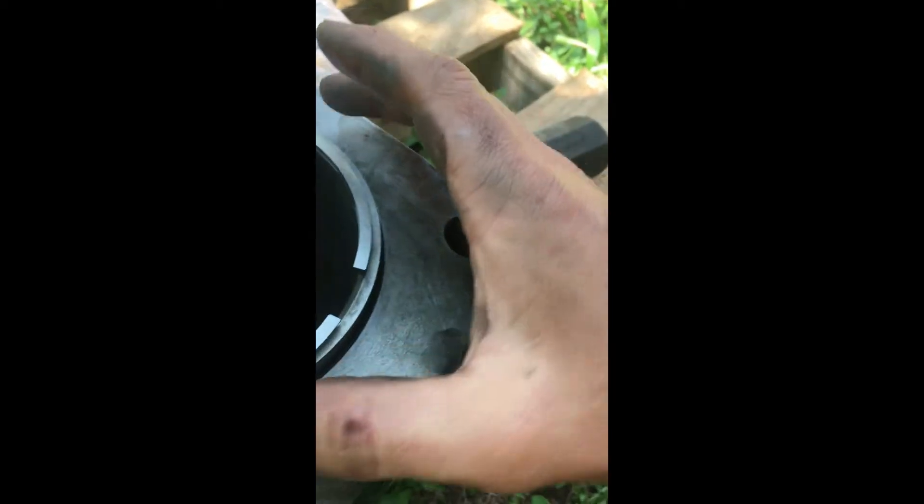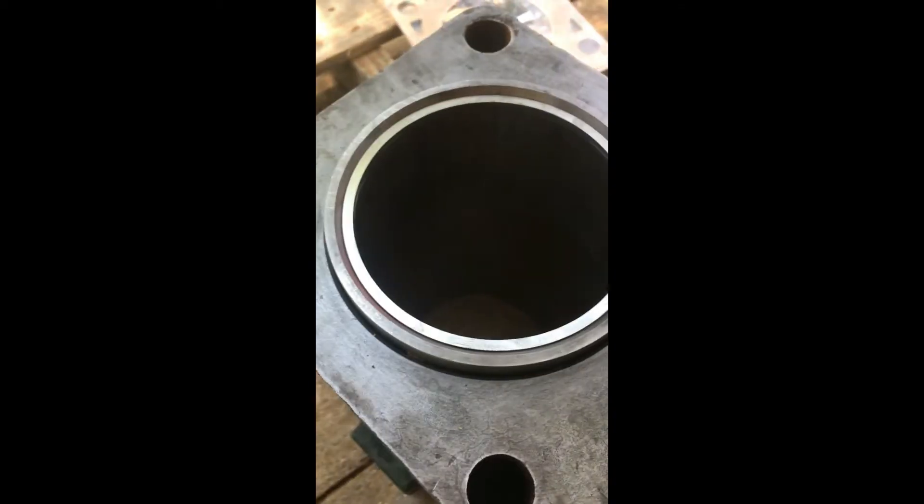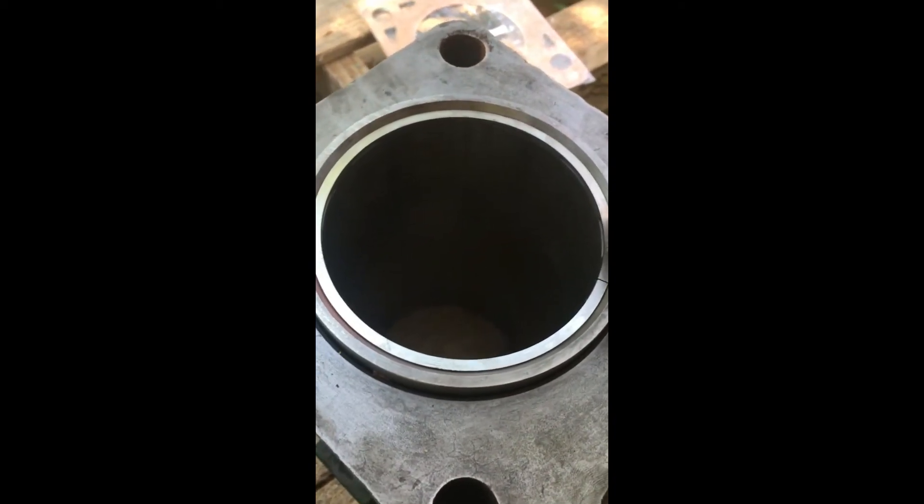One more thing I want to check — I want to put these rings inside the cylinder and make sure we've got at least some gap, but not too much. I would think too much would be better than too little on something like this. This is water-cooled so it shouldn't have too much gap. If I was a scientific sort I would get out my feeler gauges and check that, but since I don't have a spec to compare it to there's no real reason. I just want to make sure it fits before I smash it on there and break another set of rings.